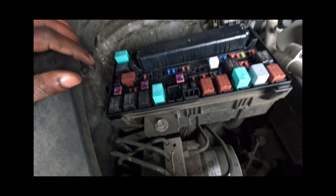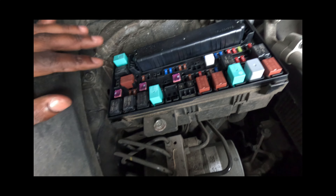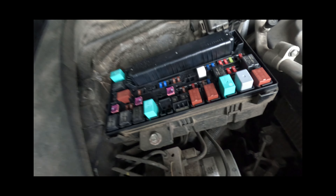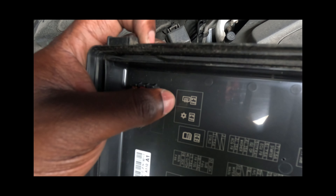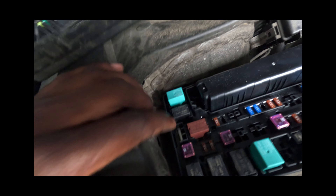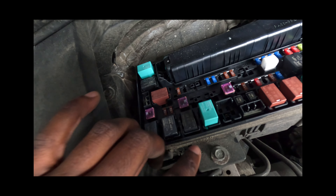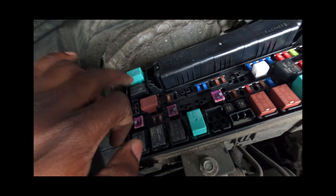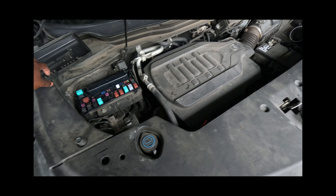For those wondering — I was not able to find the actual AC fuse in this car. The only thing I could find was the AC relay. You can see the snowflake symbol right here — that relay is the same as these others. I swapped it out just to make sure everything worked, and we're good to go. If you need to know where the AC relay is, it's right here. Thanks for watching, guys — till next time.